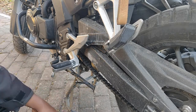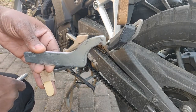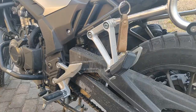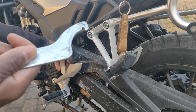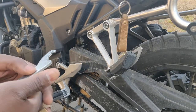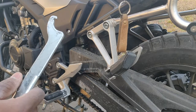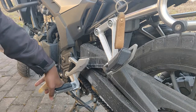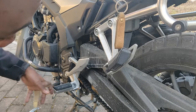I'm taking out the tools meant for adjusting the rear suspension. You have this C-shaped spanner with its extender, and it fits in like so. When you look here you can see the teeth that the C-spanner grabs onto in order for you to turn and make the adjustment. I'm guessing it should be easier with the bike on the center stand because a lot of weight is taken off the suspension and it should move more freely.